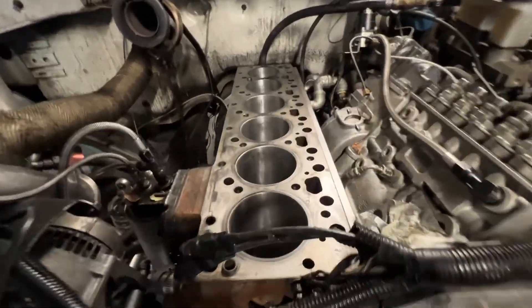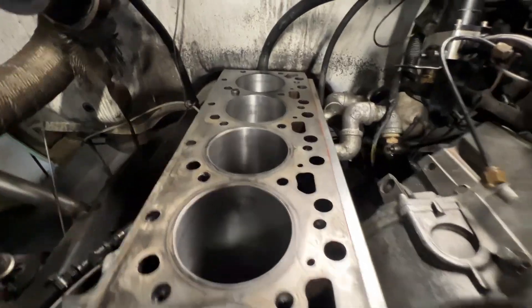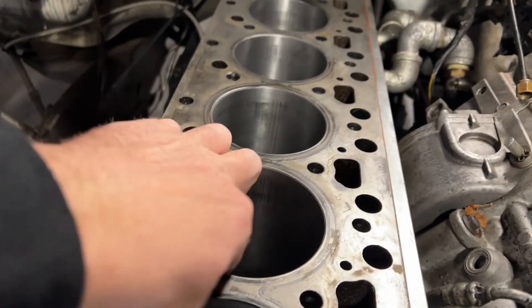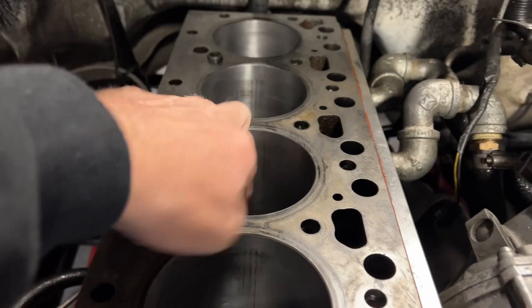It's not to say you can't do it, but this setup isn't perfect for it. Eighth mile it's okay, quarter mile just pushes it. With 150 pounds of boost, probably that much or more drive pressure, and 2,000 plus EGTs — just a recipe for disaster. Time to make some changes. Picked up a fresh hone and I'm pleasantly surprised — they cleaned up, not nearly as bad as I thought.